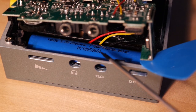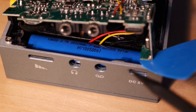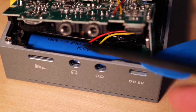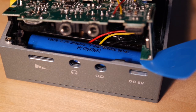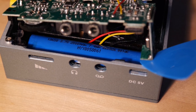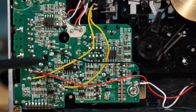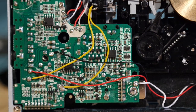I didn't want to take apart the player any further, so I'm not really sure whether you can take the battery out without pulling it apart further and maybe desoldering something — that is up for further investigation. But as someone on Reddit pointed out, this is an 18650 cell so replacements should be easy to find. In case you ever wondered what the hole on the back of the player is for, it is actually for adjusting the motor speed.